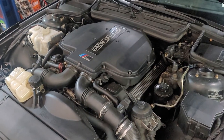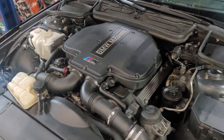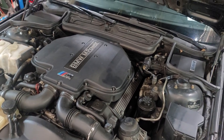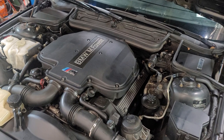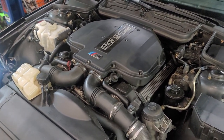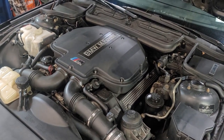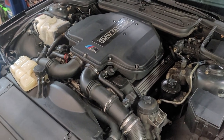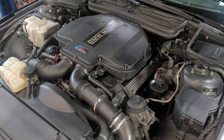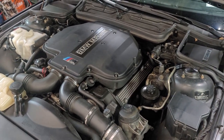We don't have any of the DME checks. I did order a module from Race German that uses CAN bus — it's a CAN bus adapter so I can wire it into the S62 DME to still get the idle bump and have the safety on the RPM and whatnot. Even as it sits right now, this does work. It doesn't get the idle bump and you don't have some of the safety on the DME side of things, but it's fully functional. Simple fix.